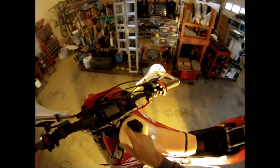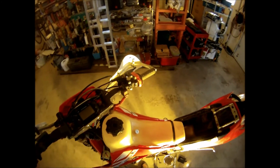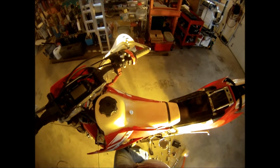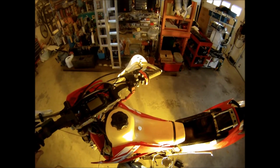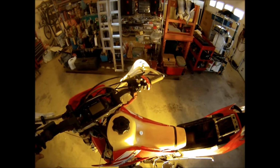So I've fried two of these. Actually, Trail Tech knows my name, unfortunately, because this is the third one they sent me. The original one that I had quit working after a day, and I sent it to Trail Tech, and they were like, oh, your regulator's probably bad on that bike. Why don't you put a new one on before you connect it to power?